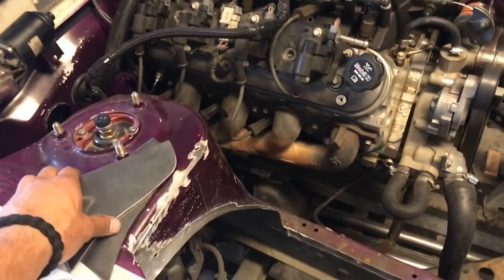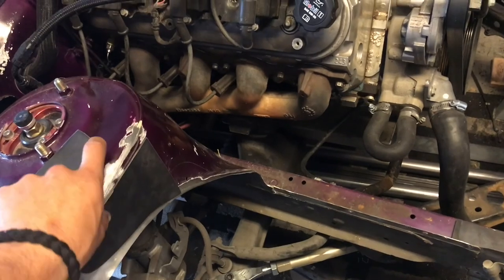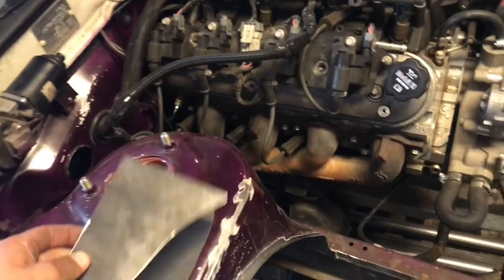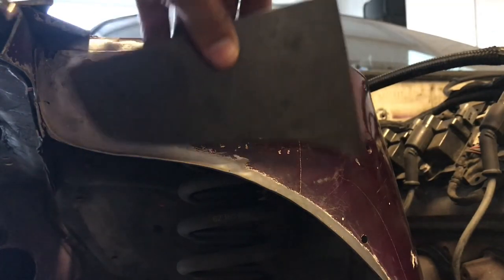For the bolt-on, you're going to need two plates for each placement. For instance, this one's going to go right here. And then this plate's going to be welded onto the strut tower, and then this one is going to be bolted onto the welded plate. So my front end's going to be welded in three different places — the first one is going to be at the strut tower.